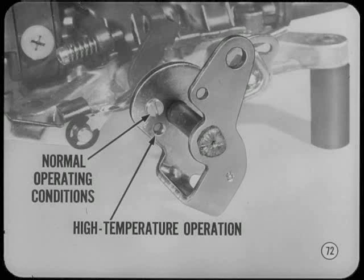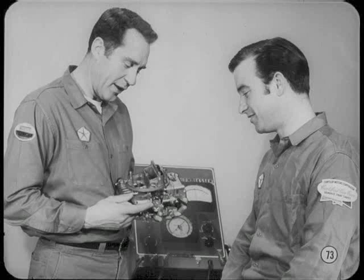And that brings us to the secondary section. This diaphragm unit opens the secondary throttle valves when airflow through the venturis creates enough vacuum to overcome the diaphragm spring. No adjustment is needed here, but if the diaphragm is replaced for any reason, make sure the replacement spring color is the same as the original.